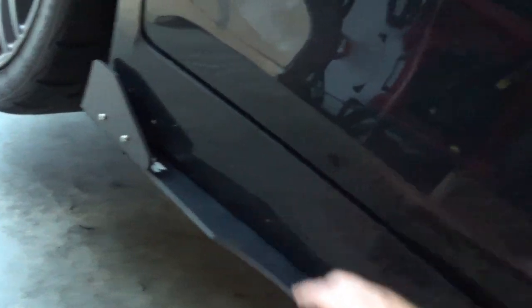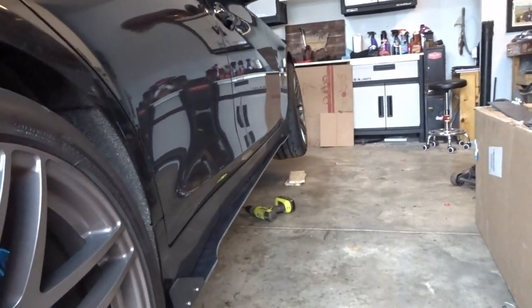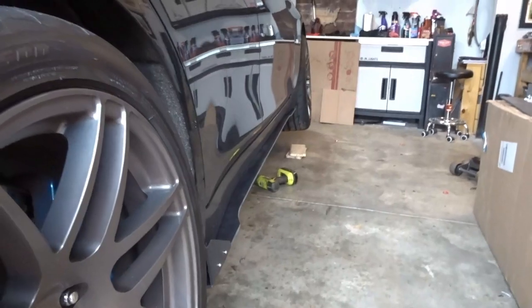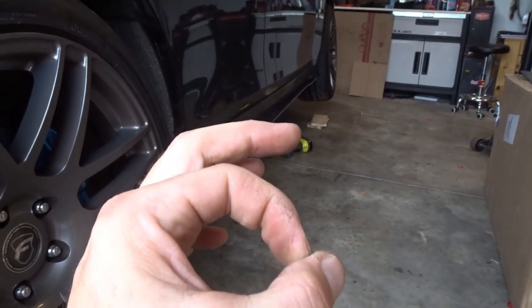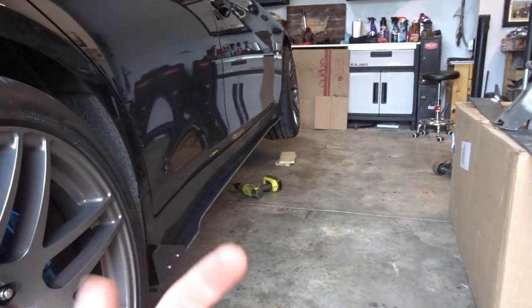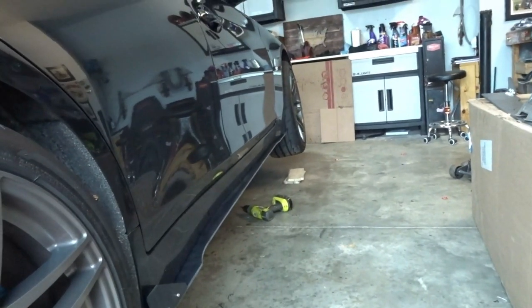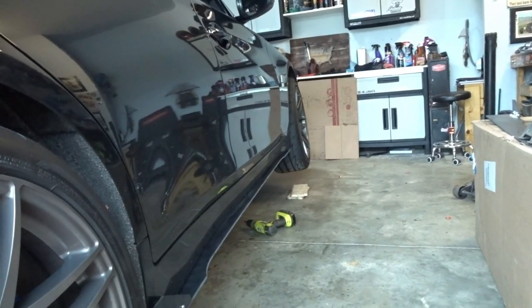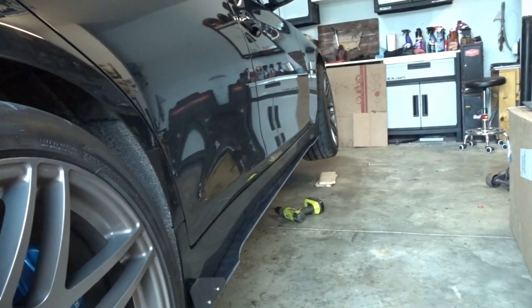It's really flimsy. We're going to need way more screws I think, or more tape — I think that's going to be the answer. Some big fender washers would make a big difference too. It's pretty much relying on these small self-tapping screw heads to support all the weight and force going down the road. If you widen that contact area with a large fender washer, it distributes the force up on the splitter to the car. So my recommendations: get some additional self-tappers, get some 3M double-sided tape, and get yourself some fender washers.